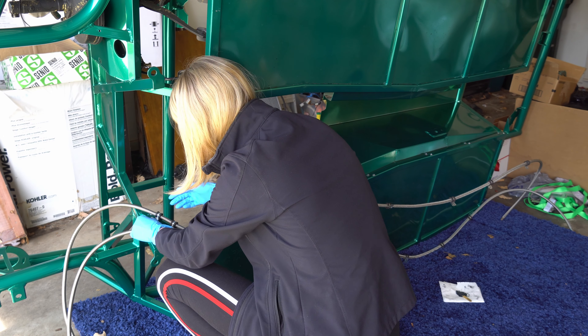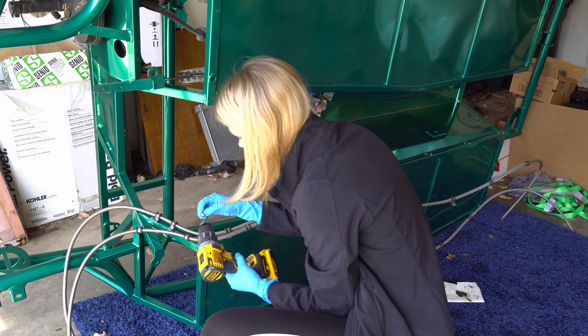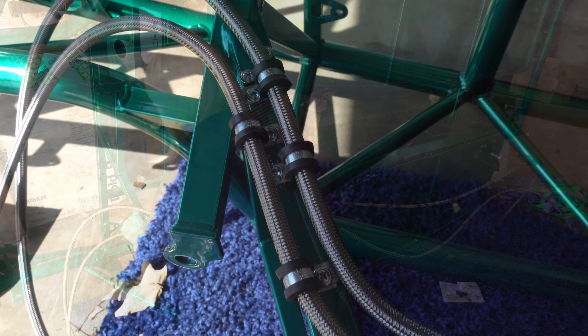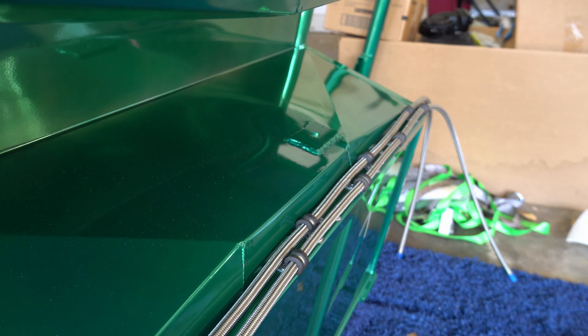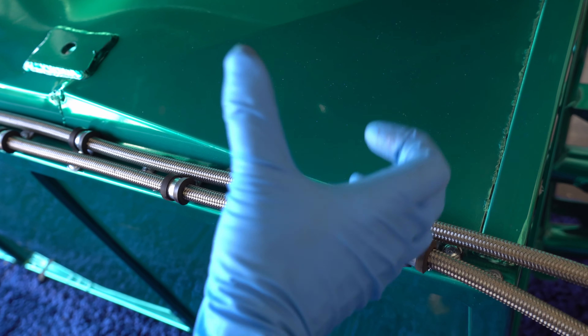Now that I have the holes pre-drilled, I use self-tapping screws to set these in. I'm likely going to have to thread lock these, but right now I haven't done that because I might need to move these a little bit back to make sure I have enough line to the fuel tank. And don't worry if you got this kit with only one line — I have an NA so that requires a return line back to the front of the engine from the fuel tank, which is why I'm running two. Keep this line at the base of the tunnel as you'll run into some pinching if you run this up closer to that fuel tank.